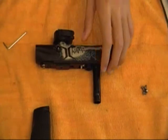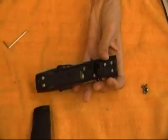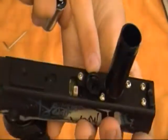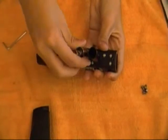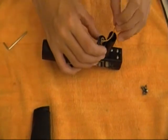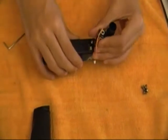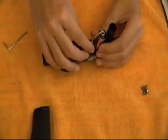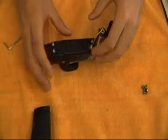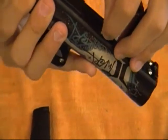The next thing we're going to do is install the solenoid. Take the solenoid and simply screw it into the slot. Make sure not to cross-thread it. Take the wire up above and snug it down with your fingers — you don't want to use a wrench or anything on it. Then go ahead and plug the solenoid wire back into the board itself, the eye sensor board.